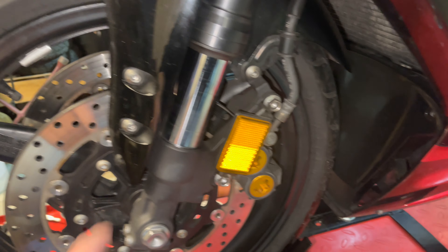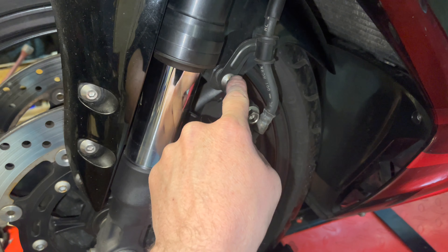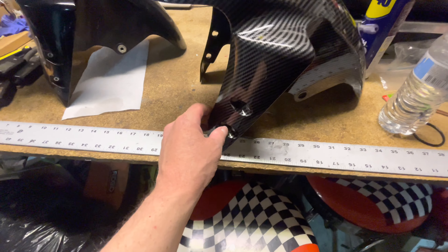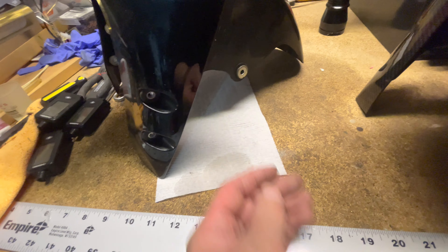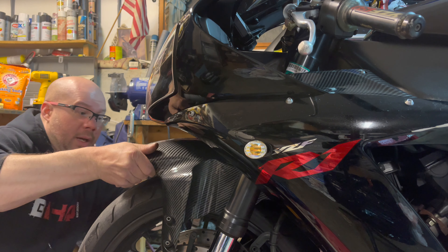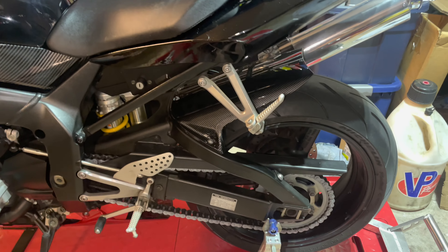Next, to get out the front fender you're going to have to take out these three bolts, and there is a nut on the back here, so you're going to have to put a little 10 millimeter wrench in the back while you use your allen head to take that off. Once all your bolts are out, grab this straight out — make sure when you're pulling it out you lift it up and then pull it out, and be careful not to scratch your fenders. Next you're going to have to replace the hardware that's on your current fender and put it into the new one — take the little spacer out, same with this side as well. To install the fender back, lift it almost towards the top like it's almost touching the fairing and then it'll just go back down into place, then put all your hardware and other pieces back on.